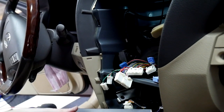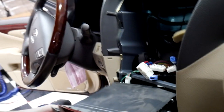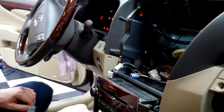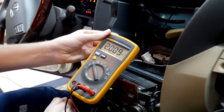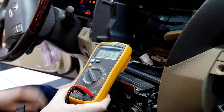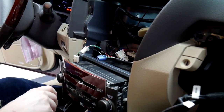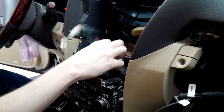We just redid the p-tap and put it back in. We've got our multimeter here — going into reverse now, we're getting 12 volts. Before we were getting zero. Always double-check that. If you do have any screen recognition issues where it shows the CD changer and says something like track 25 or 30, that typically means the reverse wire isn't hooked up correctly.